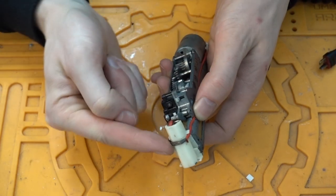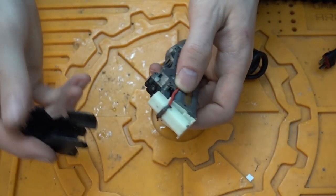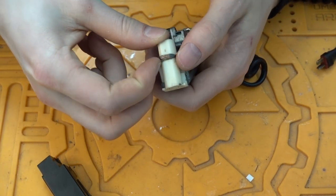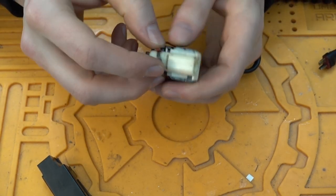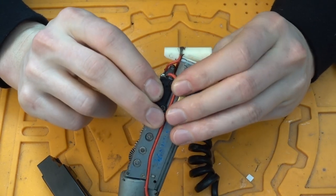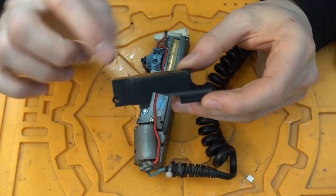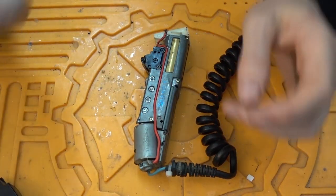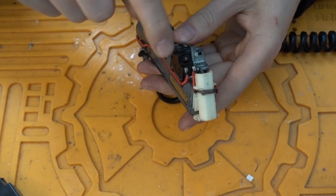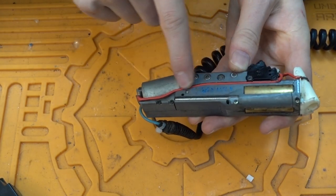The reason I removed the insulation of this cable is because there is a cover that will go on here, and if you don't remove the insulation you don't have enough space. To make even more space, I took a Dremel and cut a tiny slot in here, so the wires rest flush with the housing. This means I can still fit the cover nicely. Then I'm going down here to one side of the switch unit — the one on the inside — and connecting another 0.75 square millimeter wire there, which then goes down the gearbox and onto the plus pole.